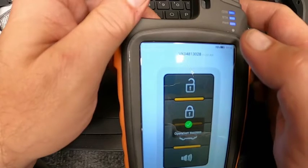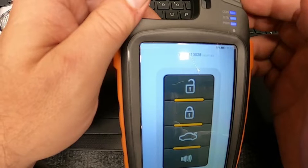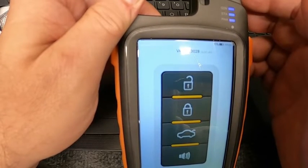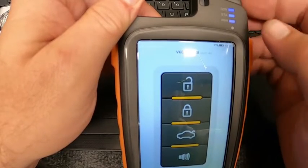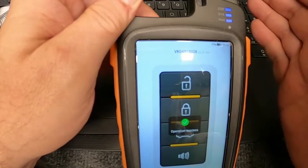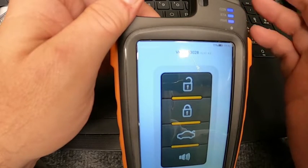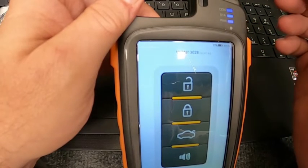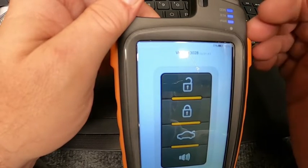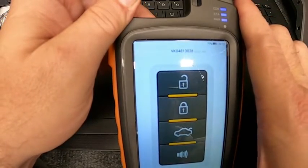You can sit there and actually go through the vehicle. There's also a way to test the vehicle to make sure the system is working — if not, you'll need to troubleshoot further. You should hear the vehicle activate the door locks, you should hear the dash chime depending on the system, and your programmer should say that it recognized the remote. Once you're done with that, you're done. Just a quick tip — go ahead and quit it and shut her down.